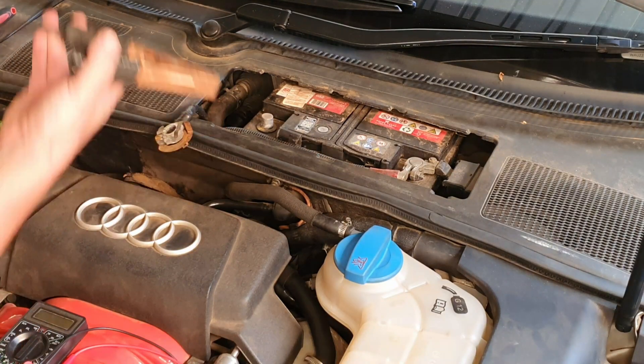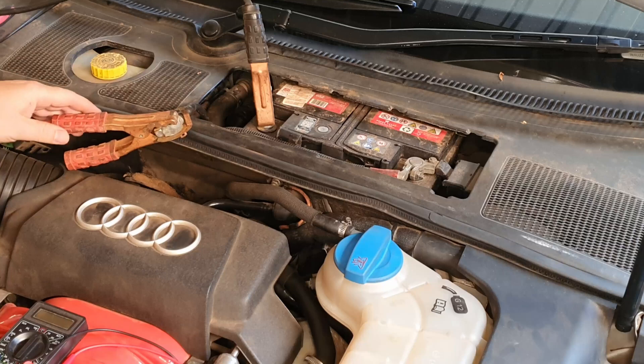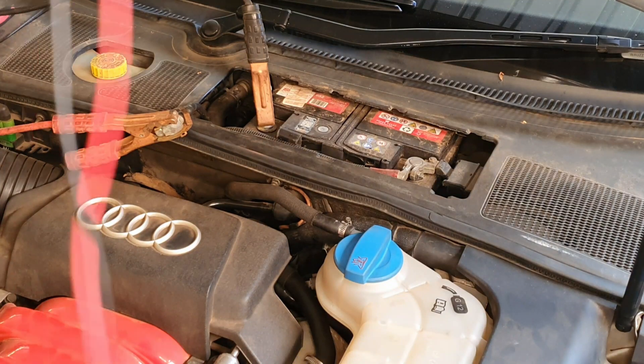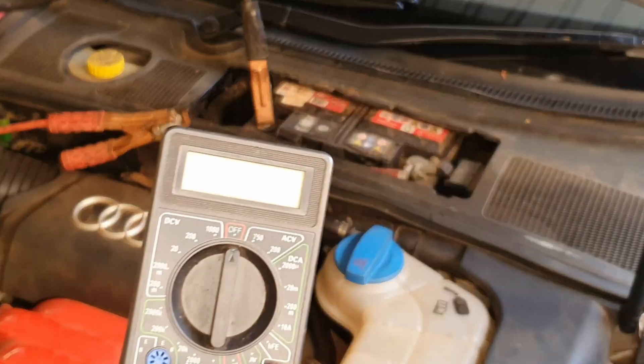In my case, in order for the video to work a bit better, I'm going to take a set of jumper leads and connect one to the battery and the other to the battery terminal, making sure they don't touch anything metal and are still isolated. Then the two other ends I'm going to put inside the vehicle, and on those two points I'm going to connect my multimeter while we're testing to see what the parasitic draw is caused by.